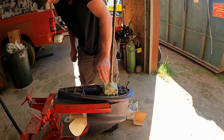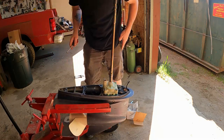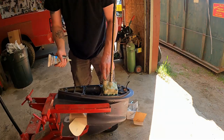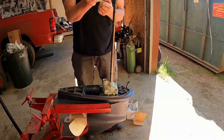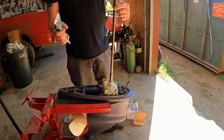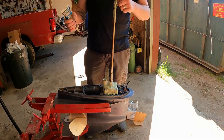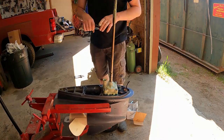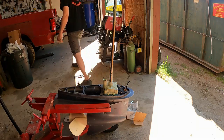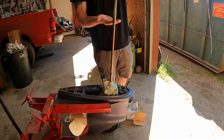There's the new one. Just goes in the opposite direction, locks into those. I like to put a little grease on it. Gives the tube something to slide into. A little grease on the slide of the splines. Don't put grease on the top. If you do, just make sure it's a very, very thin layer, because you get buildup of grease there. There's probably a good gap, but the reason I was told that is because it could put pressure against the crank when you bolt this up.